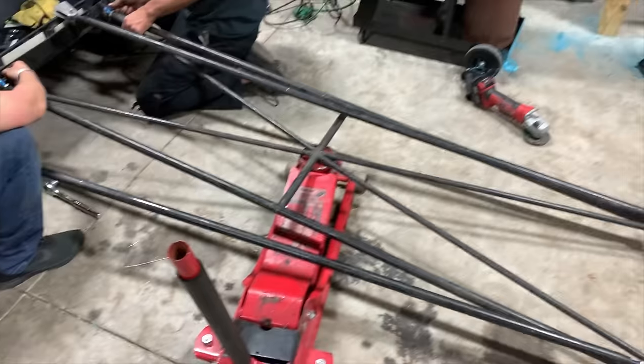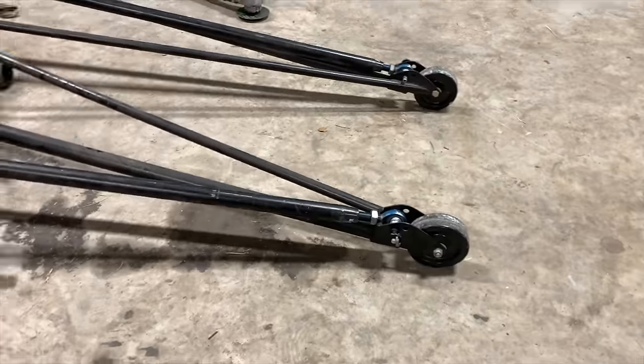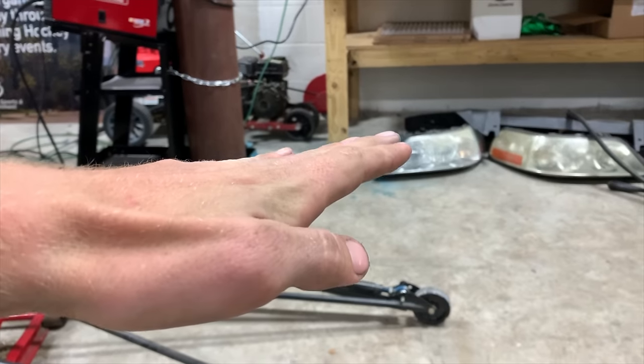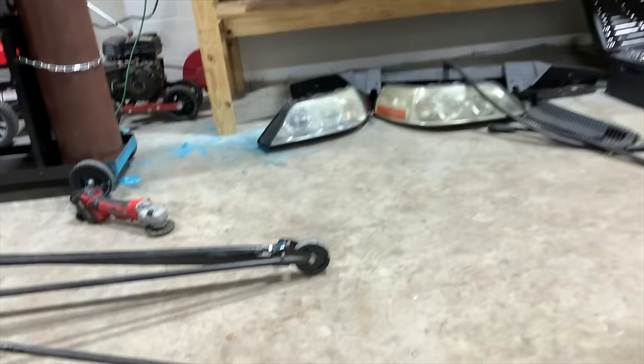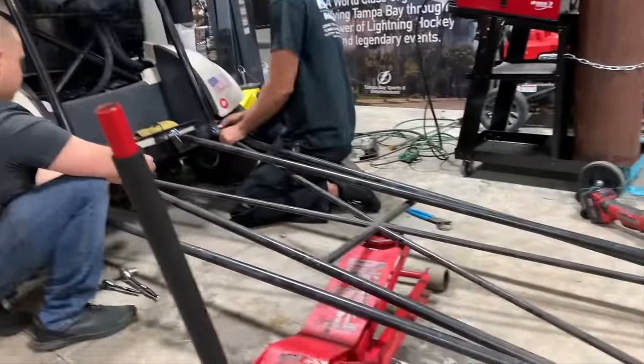Dude, guys, my back is hurting from that wheelie. So we're thinking for the wheelie bars, we're gonna have two settings, right? Yep. So this is the race setting, about an inch off the ground. And then we're gonna have tabs up higher, to where these will be up way high. We're gonna put some weight on the back of them, so when it pulls off, just a little bit of power is enough to stand it up and hold it, and that'll be a lot smoother on the transition down, not break my back.